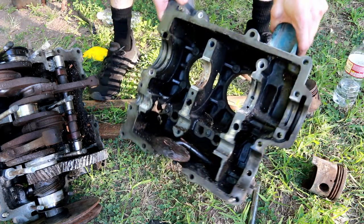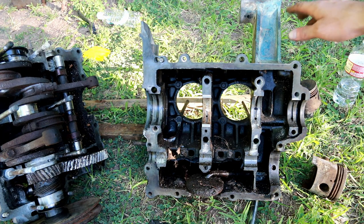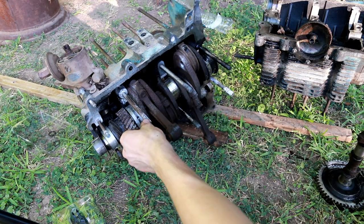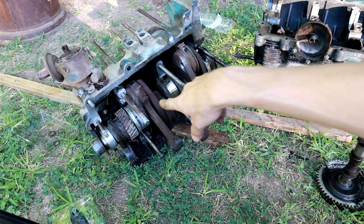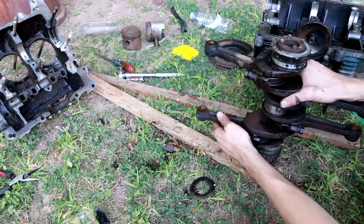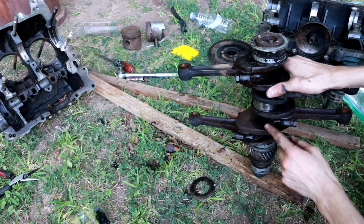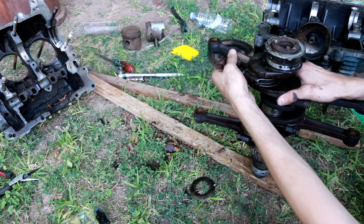As I suspected, it's completely filled with plant matter, oil scum, and all kinds of debris. This one is really almost welded up — I can get it to move if I bash on it with a hammer, but it's almost just seized up on the rod. I've fully removed the crankshaft with all the connecting rods still attached. I squirted some penetrating oil into all of the bearing journals and bearings where the connecting rods meet the crankshaft, and now they're all moving pretty freely.